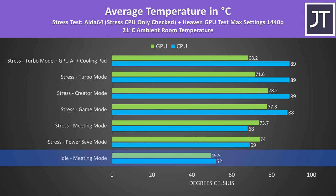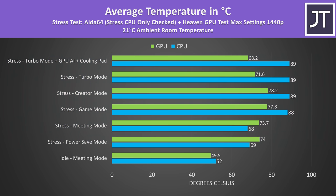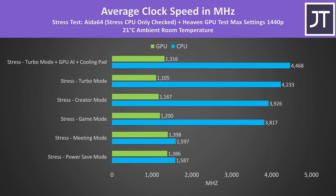The idle results are a little warm but no problem. Stress tests with both CPU and GPU loaded show overall quite good results, though Gigabyte limits temperatures at 90 degrees Celsius, which is good or bad depending on how you look at it — good in that it won't get hotter, but possibly bad if we're leaving performance on the table. Despite thermal throttling around 90 degrees in most tests, we're still able to boost CPU clock speed with higher performance modes, and the GPU speed drops back a bit too, suggesting dynamic boost is shifting more power from the GPU to the CPU in this workload.